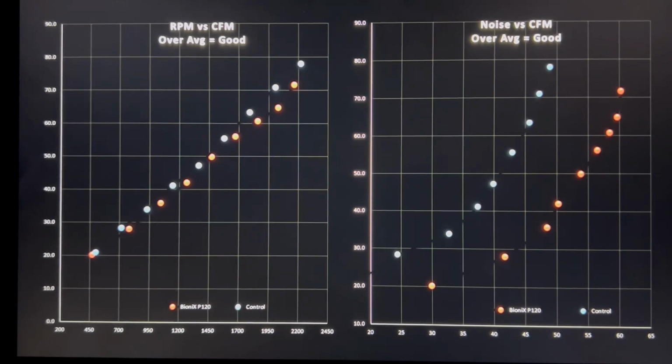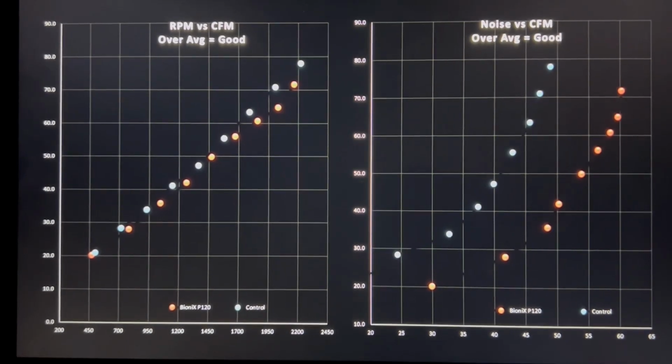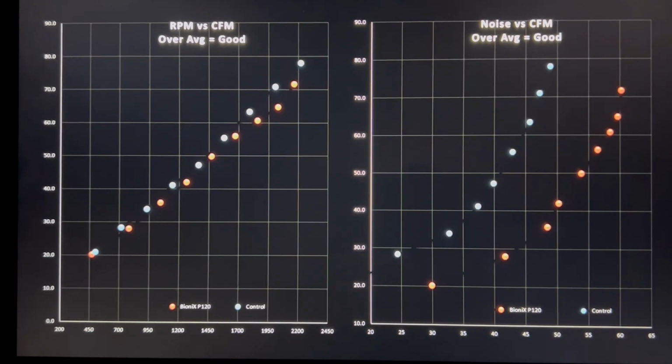But when you're doing CFM, you need to look at CFM with different obstructions in the way. I don't think CFM is very valid if you're looking at it as a case airflow fan, because when calculating CFM, you literally have a fan blowing air down a tube. So it doesn't give the air a chance to dissipate in every direction. So if a fan does fling air out to the side, it will reduce its performance, but not to the same extent as doing my case airflow simulation test. So I put it in here just for the sake of argument, everybody does it, but I think it's a little bit less of a valid test than some of the other ones that we've done earlier, which is why I put it at the end.